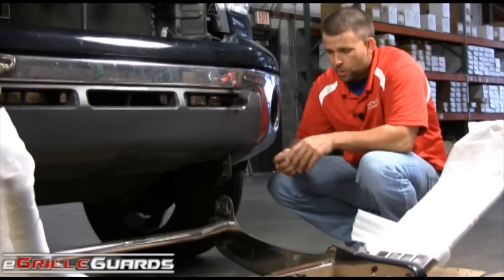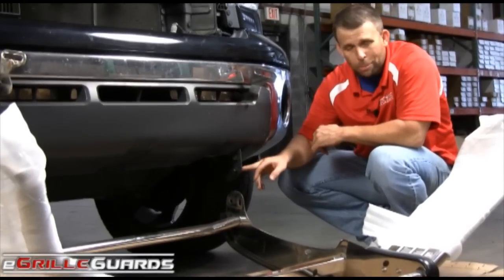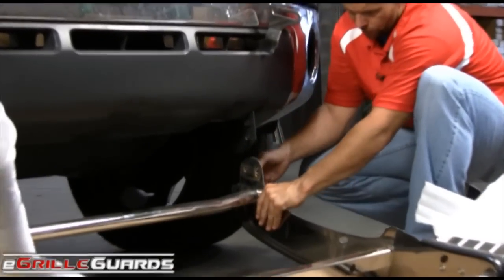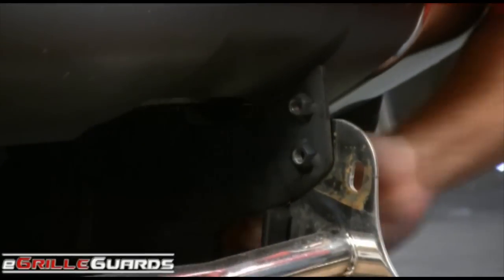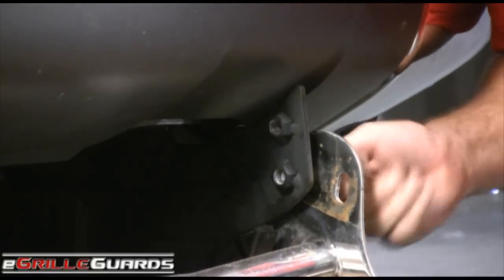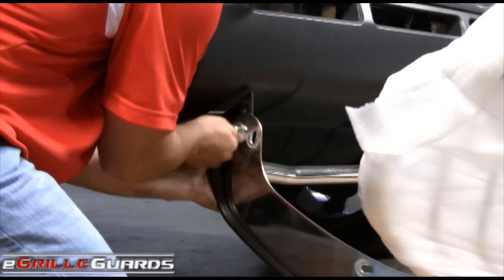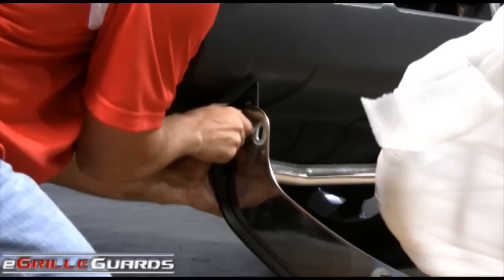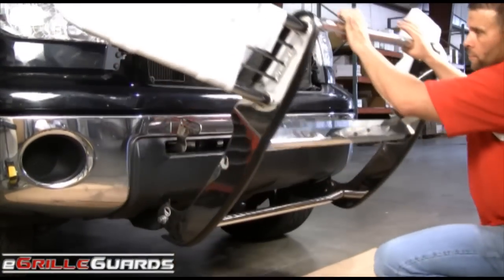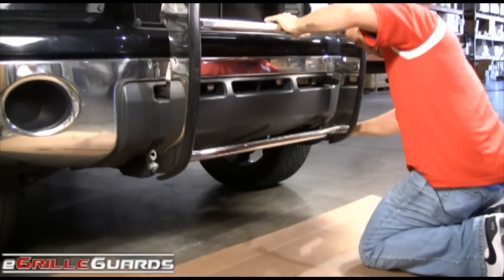So we've got our main bracket and our support bracket ready. If you're by yourself, the easiest way to do this is to apply one bolt on each side in the back hole of the grill guard, and then on the bottom hole of the bracket. That way it allows you to swing it up. You do want to make sure that your grill guard is on the outside of the bracket on both sides. Once we've got both bolts up, we're going to go ahead and swing the grill guard up. As you can see, you push it up, then take your other bolt, put it through the other side, and again just hand-tighten it.